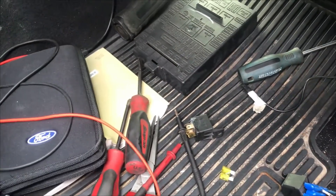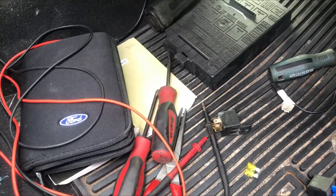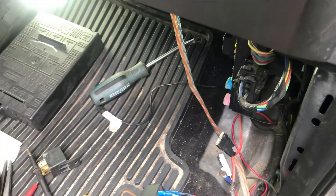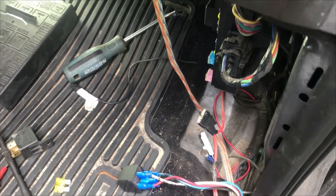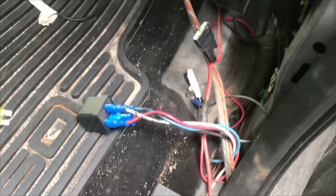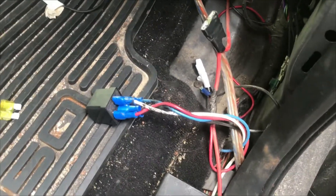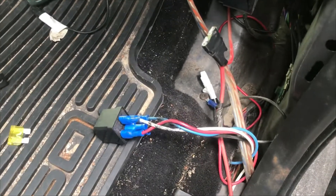All this aftermarket electronics that people put in is super time-consuming. People ask us to do installs all the time in a shop — remote keyless entries, remote starts — and there are shops that specialize in that. No shop can do that in a cost-effective way at standard shop rate. If you do this stuff yourself, really take the extra effort to tape and secure everything, keep it out of water and moisture. Even then you will have issues down the way. That's the nature of the business. Thanks for watching.